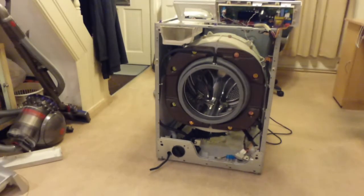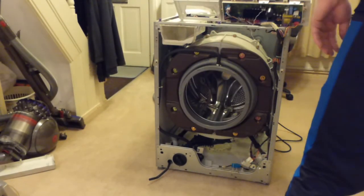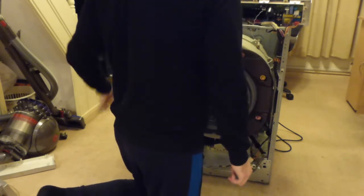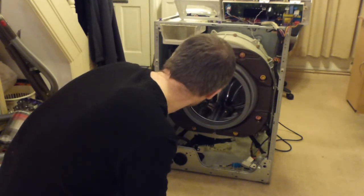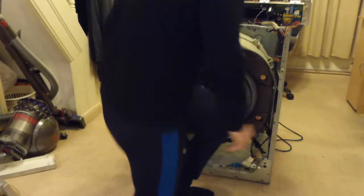Okay. So let's do that. So we want my pliers. Squeeze the clamp in. And there we go, the hose is now free from there. So now what I need to do, by the looks of things, is to remove the weights, which is 4 bolts each side, so I shall need my spanner or socket set.